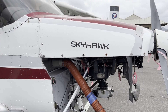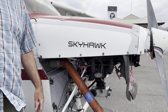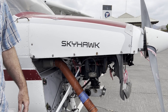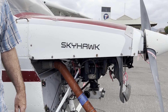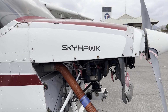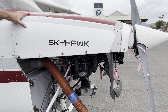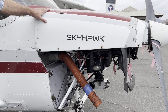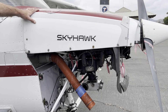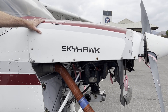I was on a 10-mile final descending out of maybe 6,000 feet and I didn't finish my pre-descent check — which includes carburetor heat on. I just sent it down, pulled the power back, and noticed my engine started getting rough. I put the carburetor heat on and the engine cleared up.